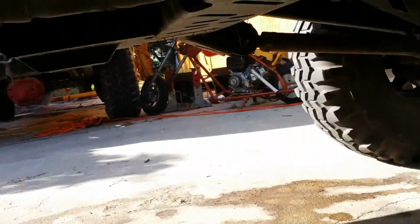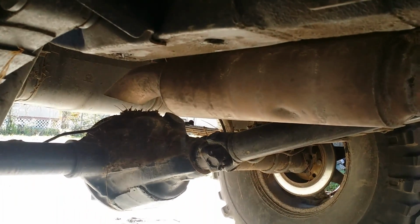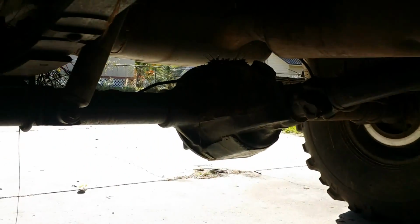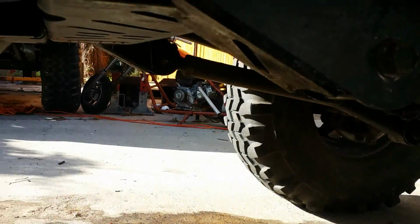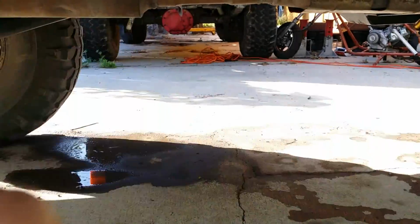See how my exhaust is just a straight shot back and then a turn down, right? It doesn't go up over the axle, it doesn't make a bend in it where it could trap water on this end of it. It's constantly blowing out right there. So if I was to shut down, it'd fill this up all the way up to that bend, but when I got it started, it'd blow it right back out. It'd be easy because it doesn't have that bend going over the axle to the back that gives it a trap, like a trap in a sink. It's the same thing but upside down. It'll trap water back in here and cause you issues, make it want to shut off.